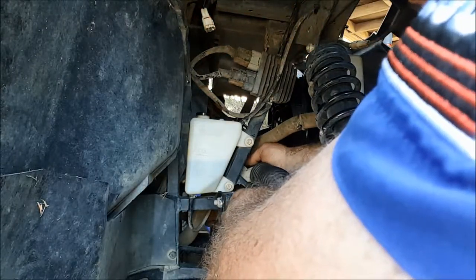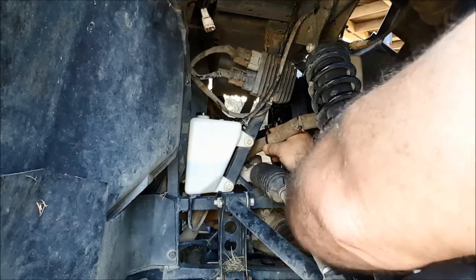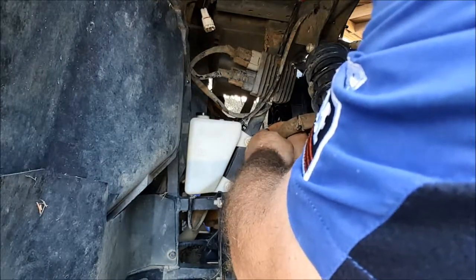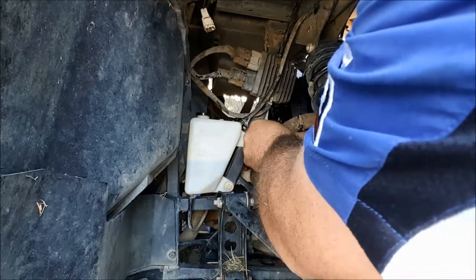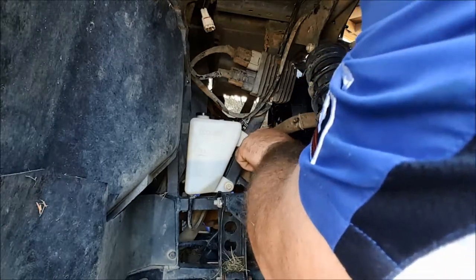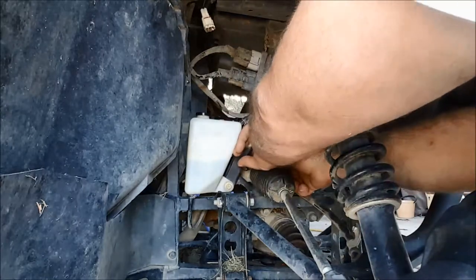I think I'd like a zip tie on that just to make sure it doesn't get in the way of the fan blades. I think we'll just put one off that coolant pipe there, look. So we'll just put a zip tie just around there, just to make sure that wiring doesn't end up going anywhere near the fan blades, because that's not going to do it any good at all. Now again, this is a coolant pipe, we don't want to restrict the flow. Just a floating zip tie, we don't want it to be too tight, but I will cut the tail off again. There we go.